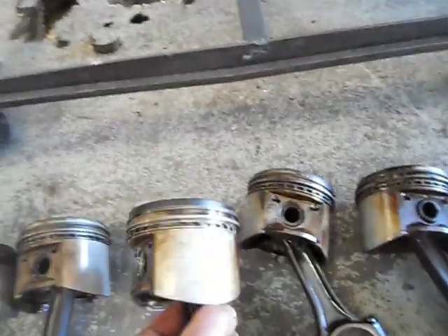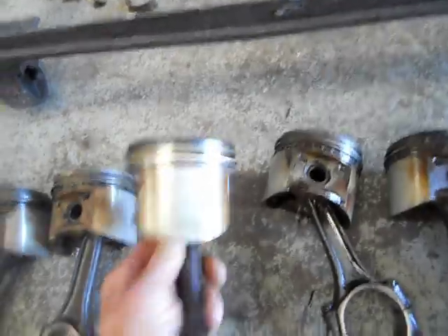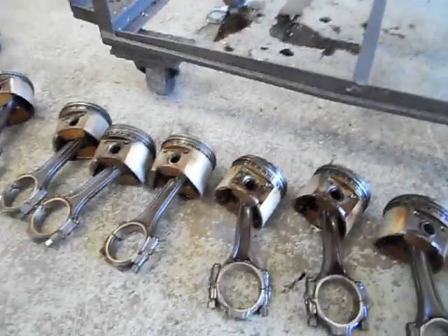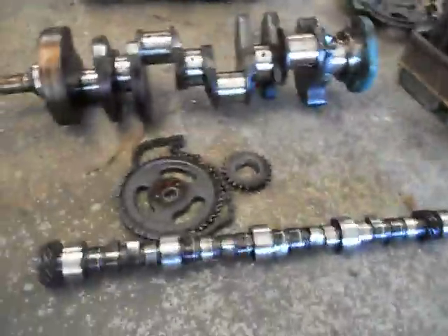The pistons, they're just not really too bad. Like I said, there's not much wear in the bore, but we're going to go with 253s — the first available size is 30 thou over if they were over — so it's going to go 30. And you can see the poor old girl, she wouldn't have been running well.